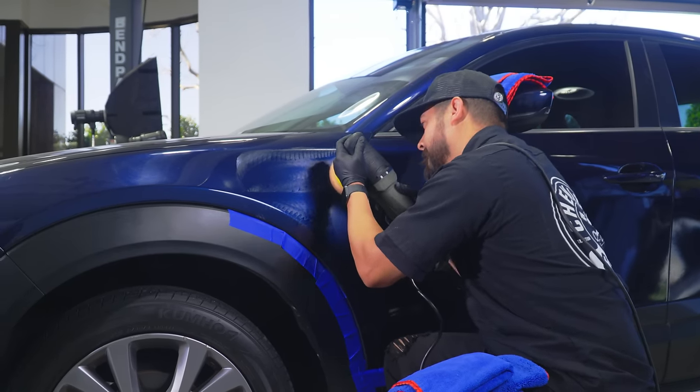So right now what we're gonna do is take off our orange pad, put on our white polishing pad, and make sure that's always centered as best as possible. And to be completely honest with you guys, I think we're just gonna have to hope for the best in terms of what this will look like afterwards. So right now we'll hit it with some jeweling polish, like some V38. And remember guys, this is a very, very fine, ultra fine polish.